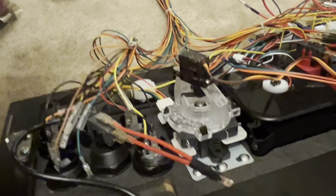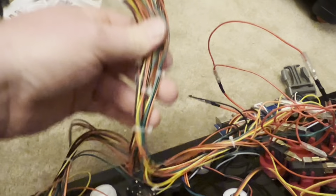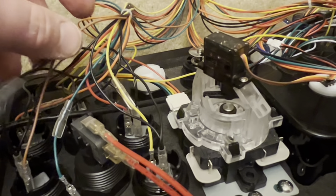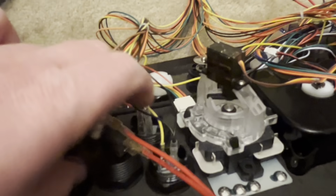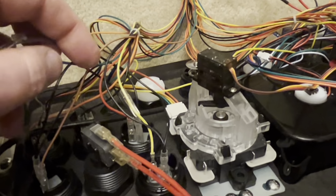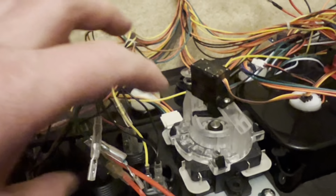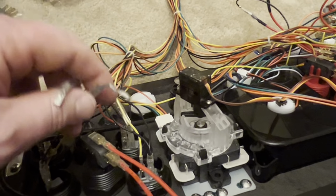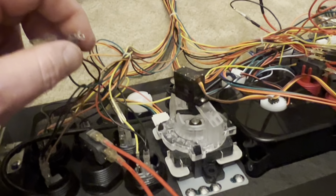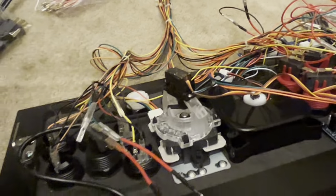On an Arcade 1-Up I usually just pull all the wires and put all new wiring in, but I can't do that here. Because all the buttons connect right there and all of these daisy chain off of each other — I don't want to mess with that. So what I'm doing is one button at a time, not pulling all these wires out. What I want to do is make sure that these wires go to this button, and then the next ones go to that button, and so forth. That means I have to do the least amount of tracing cables or figuring it out. Just do one button at a time, get it connected, then do the next one. That is my best advice for doing this.